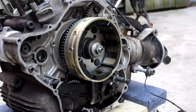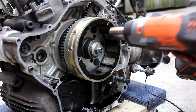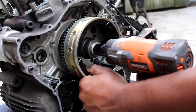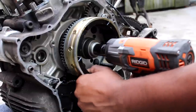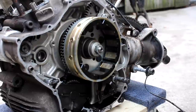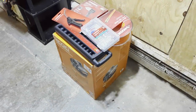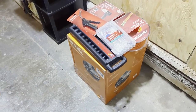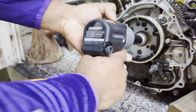The flywheel and rotor nut. By all accounts, this nut was put on there by Jesus himself, and only the strongest of air tools can remove it. Our air compressor was broken, and the air wrench was loaned out anyway, so I gave it a shot with the electric impact to no avail. It's okay though. I just moved the engine to the shed, and I'll come back with the big guns. Anyway, we got the new air tool set up with the big 90 PSI half-drive wrench. Blew that nut right off by pushing it to 115 PSI.